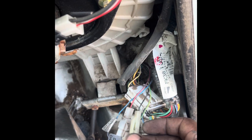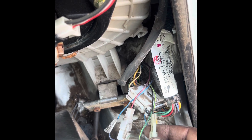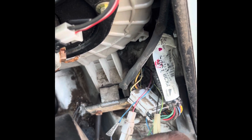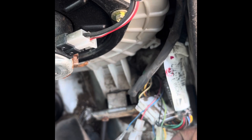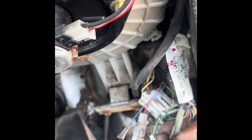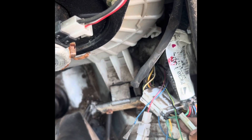Pull this, turn on your key — disconnect this connector, turn on your ignition key just to the run position, and then the light will illuminate in a certain pattern, and then you can deduce what's going on based on that. I'll give you an example here.